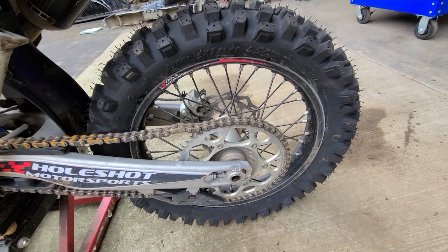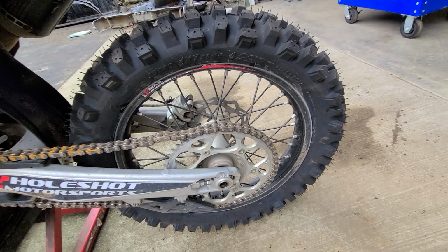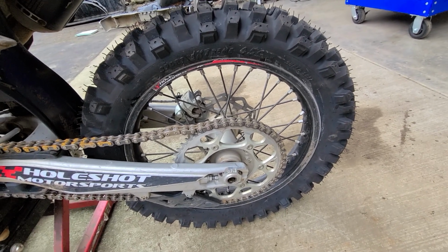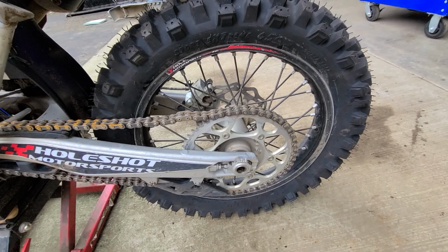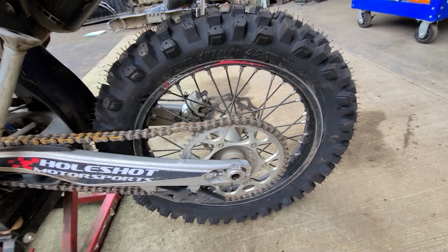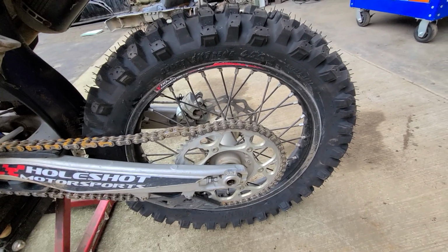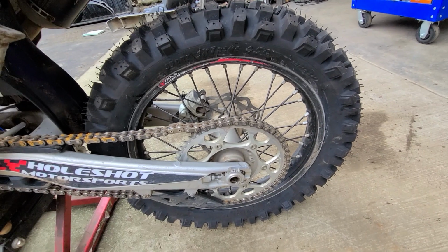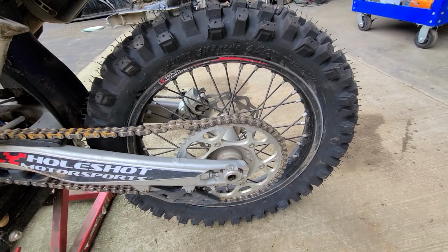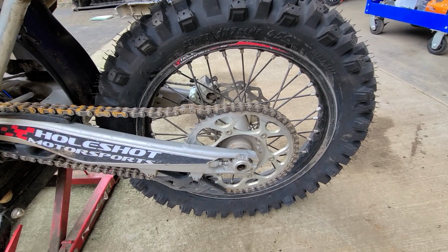So I have a special mousse that there is one factory in the world that makes, a very lightweight mousse that's soft, and it's got a good volume, so it fills up the tire but it's still soft. Makes the mousse last longer, and it's got a really good feel to it. And being light, it's lighter than a heavy duty tube, so you don't get any extra weight on the vehicle like you do if you're running something really heavy like the nitro mousses.